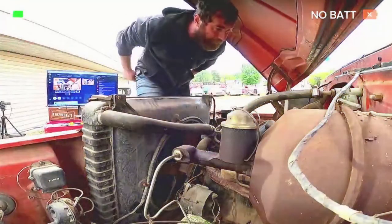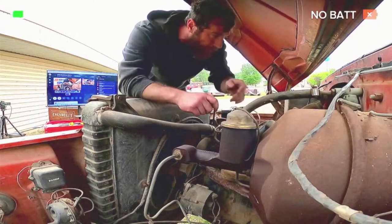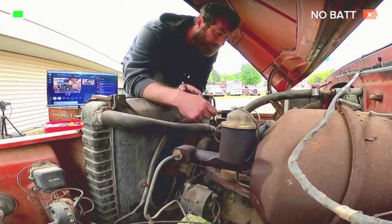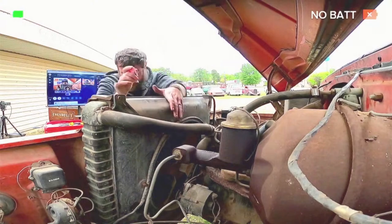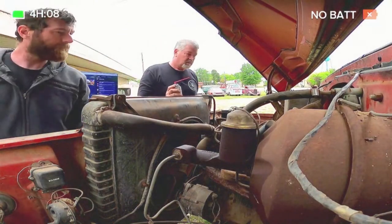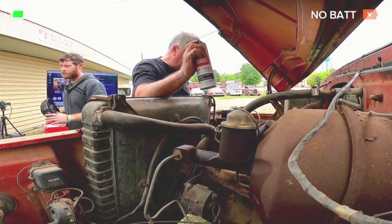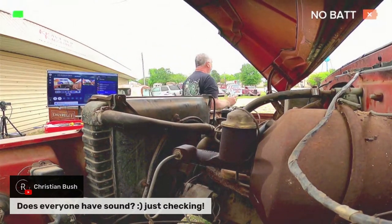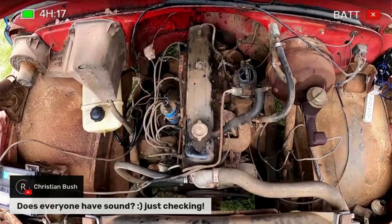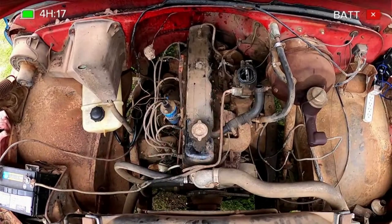You might press it a couple times. It sounds like it's pumping, squirting it in there. Yeah, we'll try that. I'll play around with that choke some too and see what it does. It just acts like the fuel pump's not, or something's not steady with it. If it's got fuel in the bowl, it has to be squirting in there, but it's not staying steady. It revs up and revs down. Hey, I'm going to try to choke it some. Yeah, it choked it some.